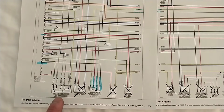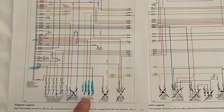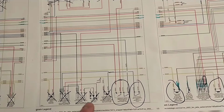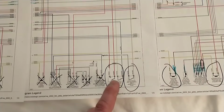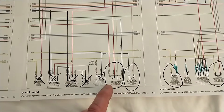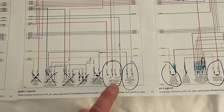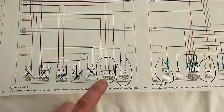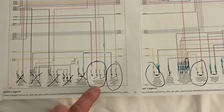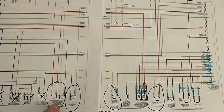I haven't actually counted, but you've got your throttle position, your map sensor. Again, that's already done. Then we'll go to the next page. Almost everything gets deleted. This is your brake pedal switch and your clutch switch if you're going to do cruise. Otherwise, you will still need the brake pedal wired if you don't want that dead pedal when you first take off, unless your tuner can go ahead and just turn that off for you if you don't ever plan on having cruise.